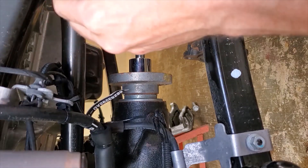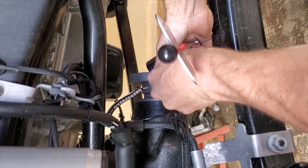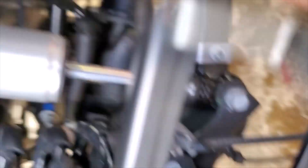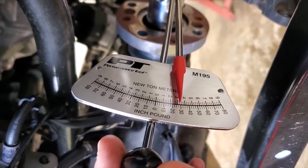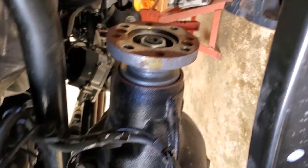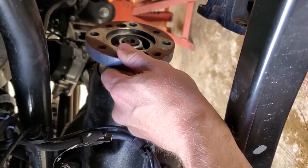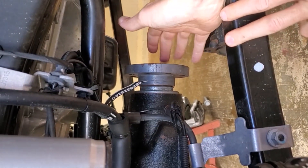There's no oil in it — obviously because I dumped all the oil out — but it looks like it's deflecting about 30 inch-pounds. As I push it to turn it, it's going, going, going. There's 30. So as it starts, you can see it start moving. I'm right around 30 to 35 inch-pounds to move it. It's on the snugger, tighter side because there's a crush collar in here and I'm going to have to replace that. It's crushed probably a little on the tighter side, but it's okay because once it gets lubrication it will allow me to move this a little freer.